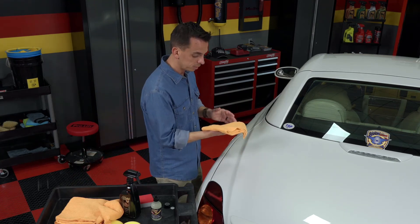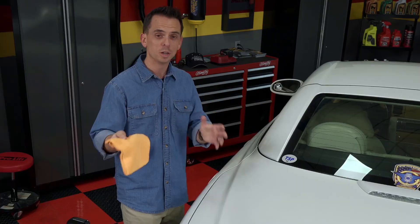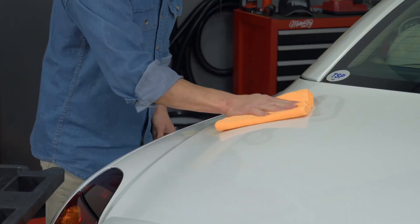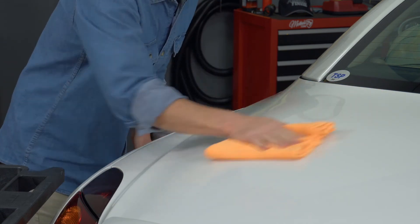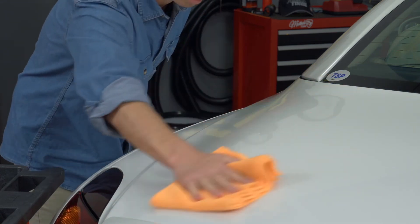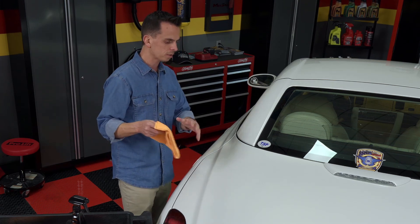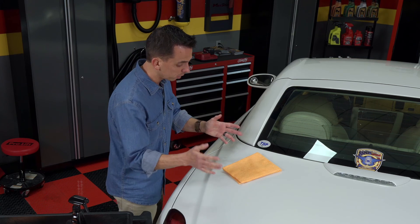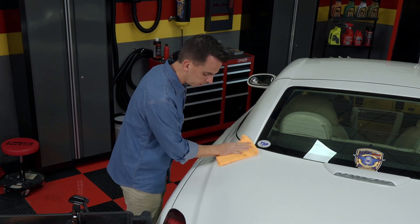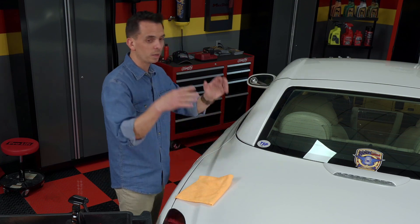After you've applied to a section, take a microfiber towel — use really high-quality, lint-free towels that have been washed. Do not use inexpensive towels from the store sold in big bags; they won't work. Fold your towel four ways and take short, firm strokes. It also helps to use the buddy system — have a wife, husband, child, neighbor, or anyone follow behind you to check for high spots, which is just a fancy word for excess coating. This is really easy to wipe off, but buy a coating with great reviews where people say it's easy to wipe off. After short firm strokes with no more residue, quickly go over it, inspect your results thoroughly, and then repeat this process section by section.